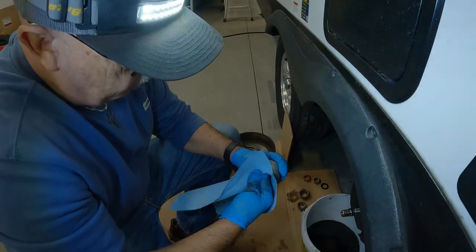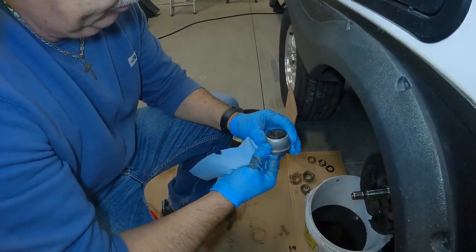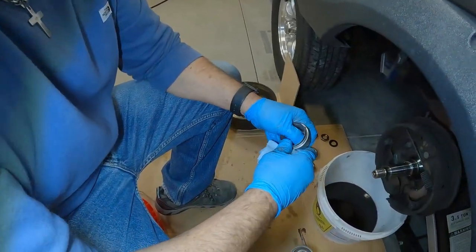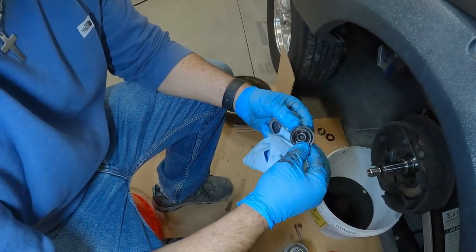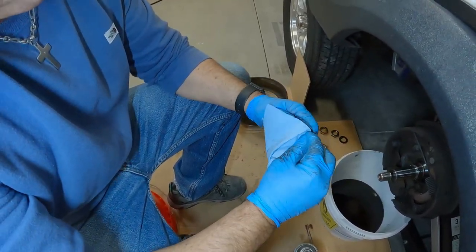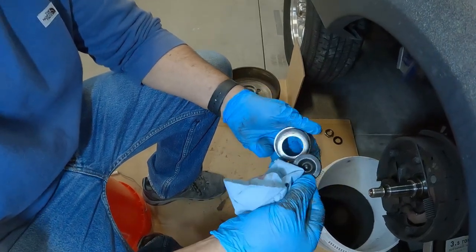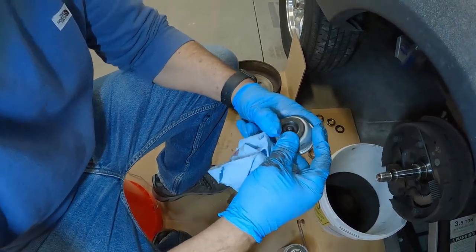Something that's really important about this whole inspection is this little dust seal. Make sure that's in good condition — the dust seal is what keeps dirt out, it's basically made out of rubber, it allows you to pop it open and inspect, and also gives access to the grease nipple if needed. Inspect it, make sure there's no cracks, because this is one place where things fail. If it's not good you need to replace it — they're really super cheap. You just pop it right back in.